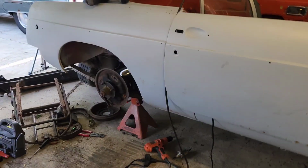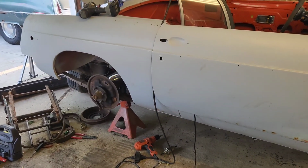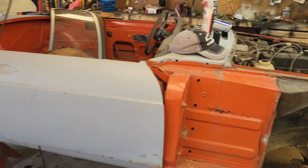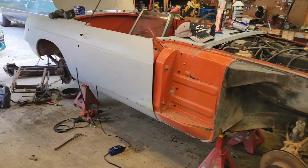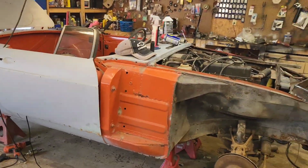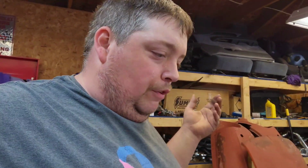That's the upside with some of these older manual transmissions, especially when they're synchronized. There's no weight on anything, so you can kind of pop it into a gear and it'll go, because there's nothing stopping it. It's not necessarily a good thing to do, especially if you try doing it and it wants to grind. It didn't want to grind in first and second. And I knew to shut it off in third because I had already tried recording that and apparently forgot to hit record. So I knew the moment I tried going into third, it was going to grind. That's why I went ahead and just shut it off. And I already did it in reverse, too. I know reverse is working.